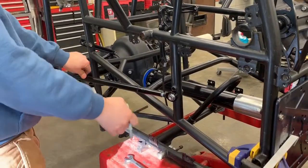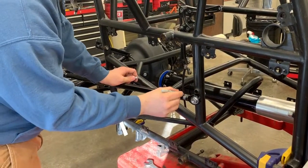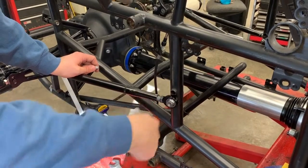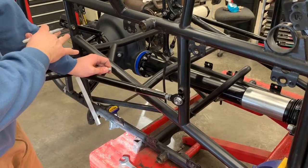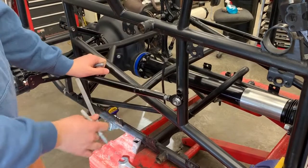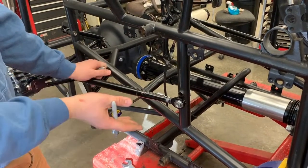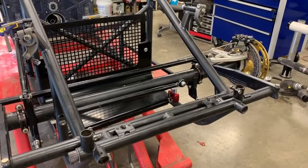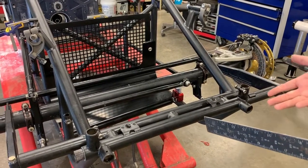Now all that's left is to jam your lock nuts. One little thing I like to do is put a sharpie mark on top, because sometimes when you're trying to tighten these, you'll start turning the rod — the mark lets you know you're not turning and losing any of your adjustments. Also, if you want to play with birdcage timing, easily count your turns and set it back. You might have to do a full check of your rear end again.